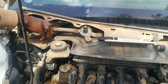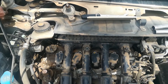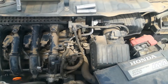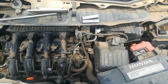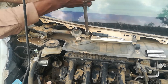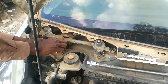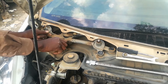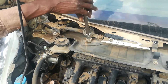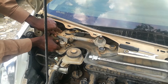Now, one major problem with the Honda Fit is that it has a second row of plugs — we just noticed that. This calls for removing all of the assembly in front of the windscreen. Under the bonnet, everything has to be removed — all these covers, the wiper blade assembly, all these fittings — so as to reach those spark plugs.